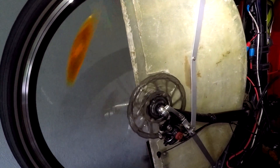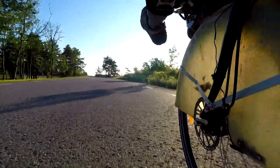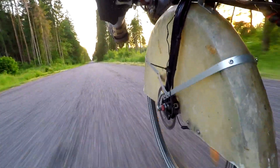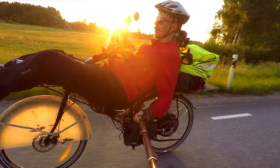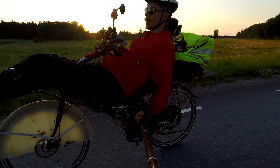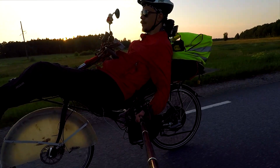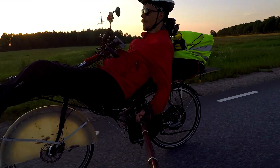However, I definitely haven't fully finished the fiberglass work — still making a battery box, a rear wheel arch, and so on. If somebody is thinking of doing the same, be careful with the fasteners at both ends so that the wheel arch is large enough. Because if the arch is too small, the fastening can bump against the outer tube, and serious accidents can happen. So, be careful!